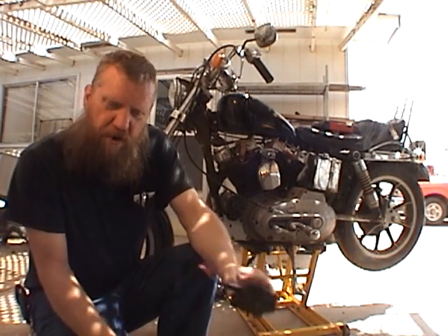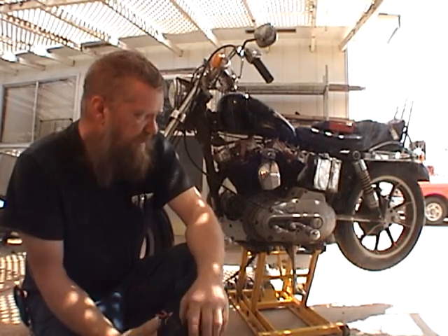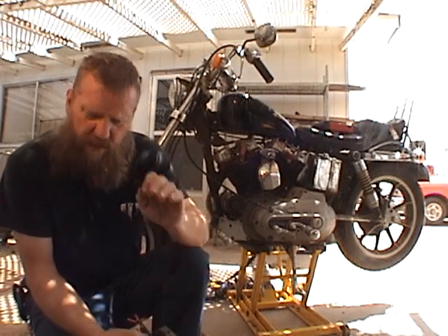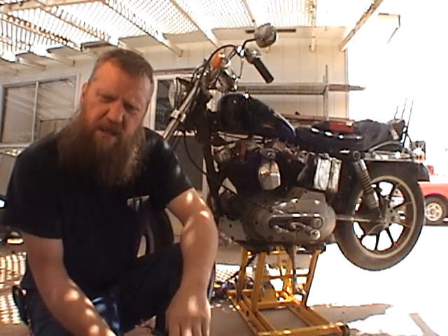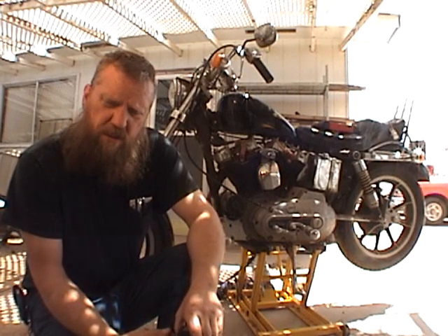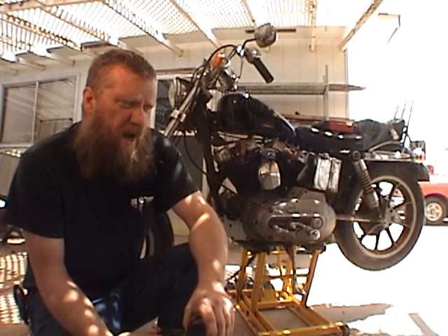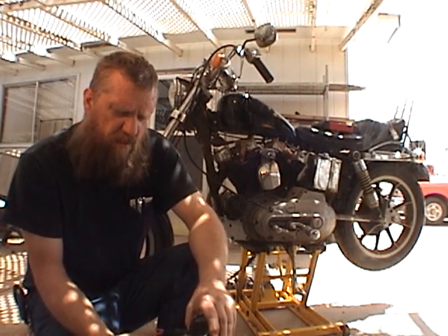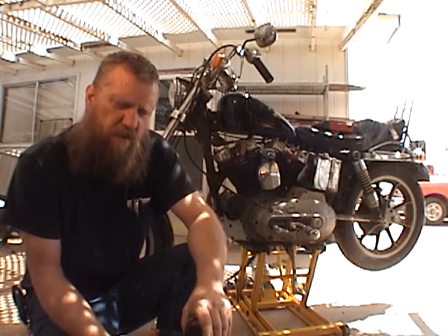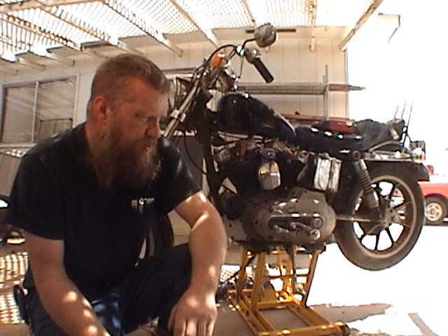So I put in a third battery. This time, when I hooked up the negative terminal, there was a tiny, tiny spark. I said there's a small parasitic load on this battery. I left it disconnected. A month later I went to hook up the battery and there was a huge spark — and this was before the key was even in the ignition. So I said there's something really wrong, there's a major problem here.